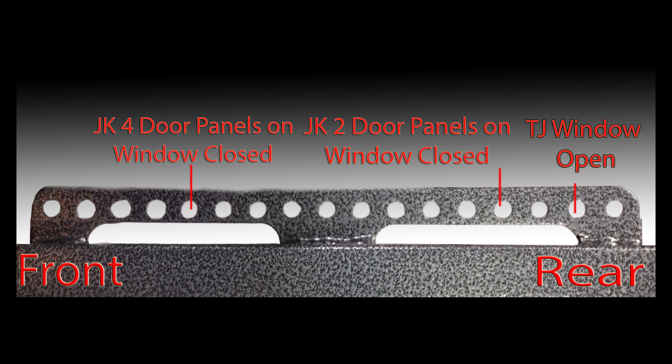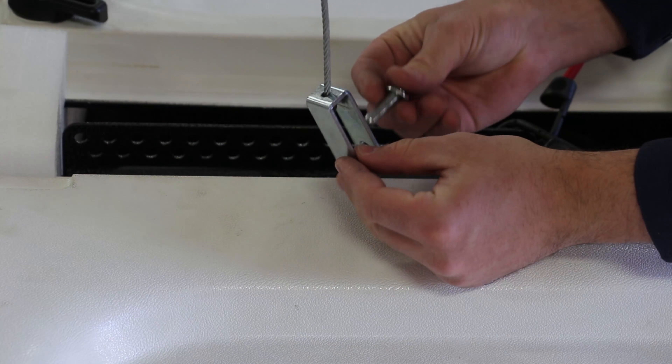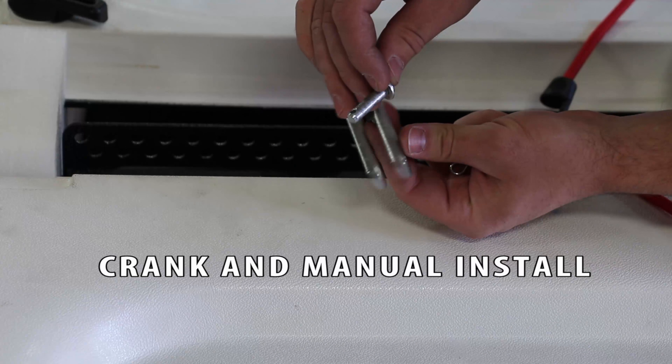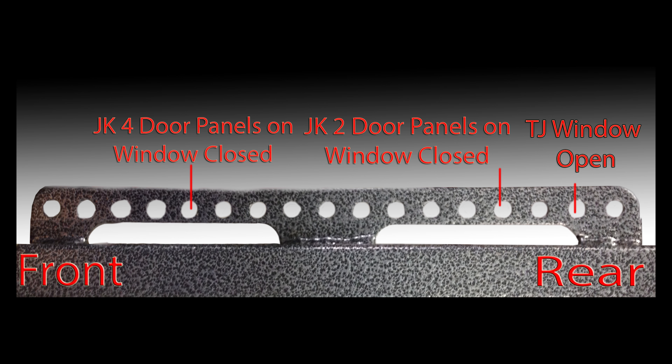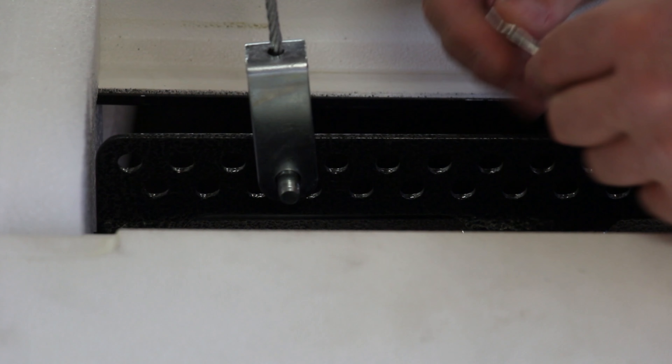Balancing: using the lifting blade, you will need to find a balancing point on the lifting blade. Below is an illustration of good starting points depending on Jeep type. Please note these are starting points and each top configuration is different. You may have to move forward or back to properly balance the top.